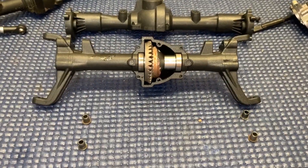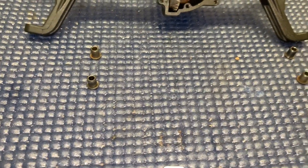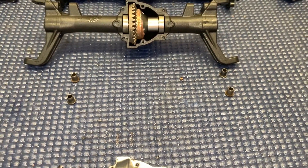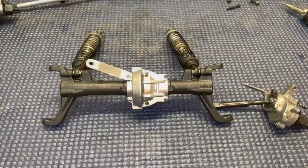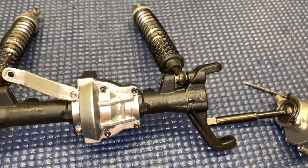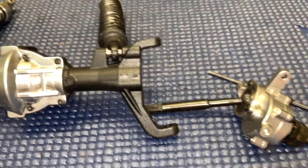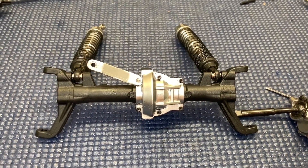With the gears in place, I'm going to add a little bit of grease to the teeth on it. When you work on the front end, be careful of these little bushings right here. Don't lose them — you'll have to reuse them into the new axle housing. Keep in mind with the front end, if you're going to put the shocks in the new double shear configuration, make sure you put that in before you put the steering knuckle on. If not, you're going to be taking the steering knuckle right back off.